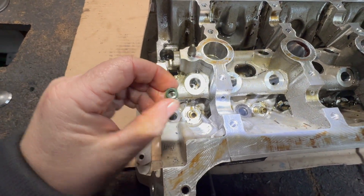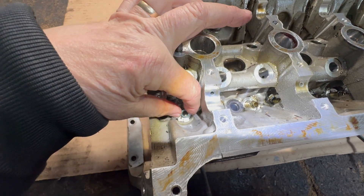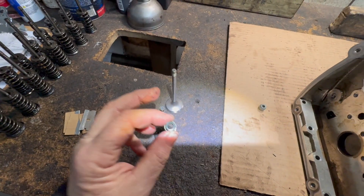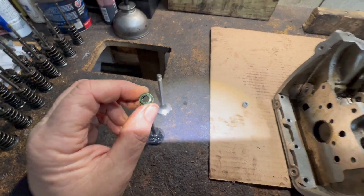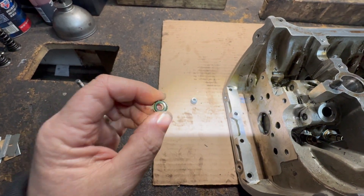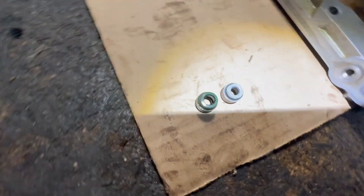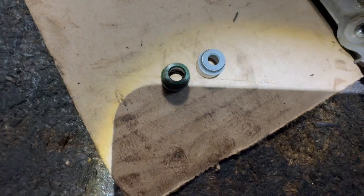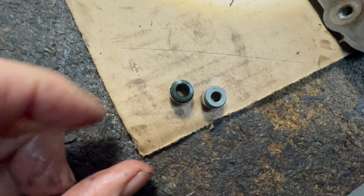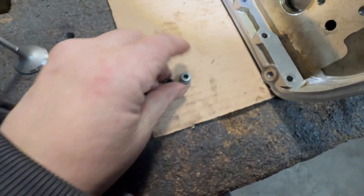So that's where the seal comes in. The seal goes on top of the valve stem, on top of the valve guide — they're tapped in. When the valve comes through the top, this is what seals it. Over time these get hard, brittle, or just worn out, and you can see these two. This is a new one. You can see the difference in the diameter of the hole. It even looks like it's a different seal, but it's not — they're the same seals. This one's new, that one's not.